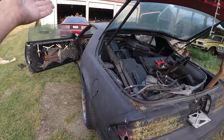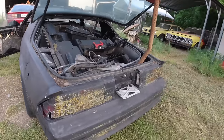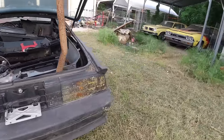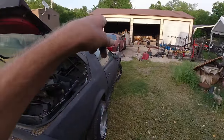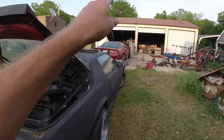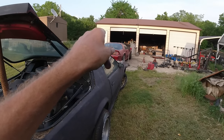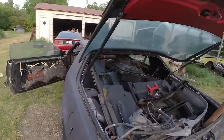I'm going to go down there probably tomorrow and order the brake hoses and swap them over and see what happens — about $40 on eBay versus $30 local. We're just doing the front for now because the rear end calipers I didn't look up yet, but they're over a hundred dollars each. If it's just the hoses on the front it's probably the hoses on the back too, so we'll start with the front.